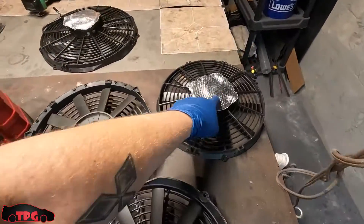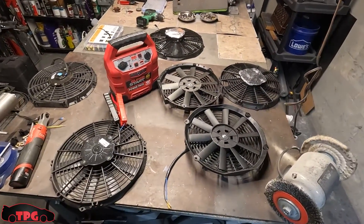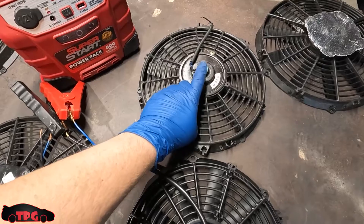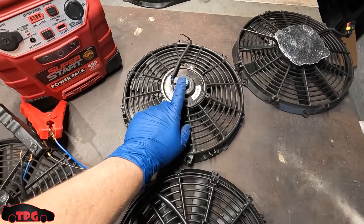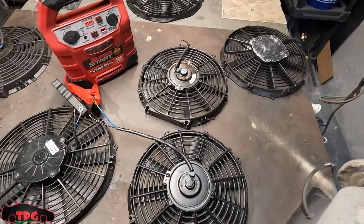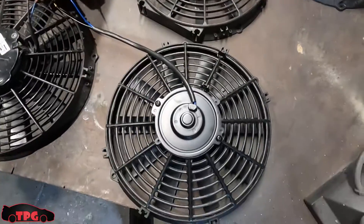I want to do a demonstration using the jump pack with my 12-inch Spal fan versus the cheap fans. So we've applied power to the eBay fan — you can see there's no torque, this thing barely tries to spin. It's really not powerful and doesn't move a very big amount of air. Looking at the blade design, the Spal blades have a really deep twist on the inside that kind of levels out toward the edge — those move a ton of air. This eBay fan on the other hand — no torque, very slow spool up.